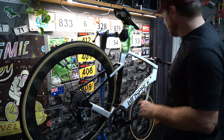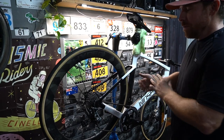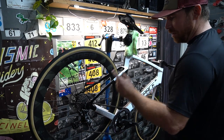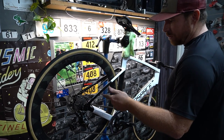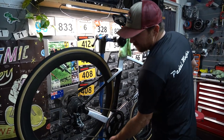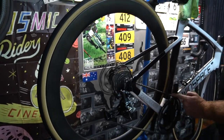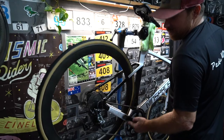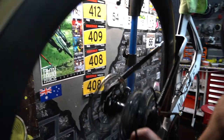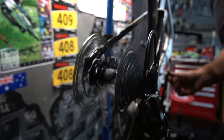What you're gonna see is, it amazes me that so many bike brands are still just recommending Loctite on things because it's always gonna bind up before it's tight enough. A fantastic indication that this axle's never been tight enough, but now it is because of the grease, is the gears have gone out. Unless you tune them to that other wheel. Nah, they stay the same. If not, you can see it's actually the bottom set screw goes that much further over to get rid of that noise.